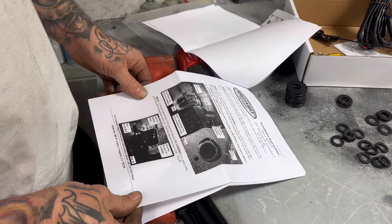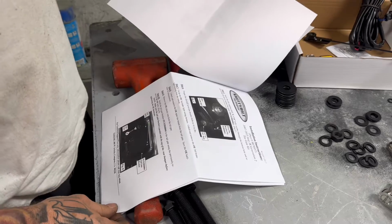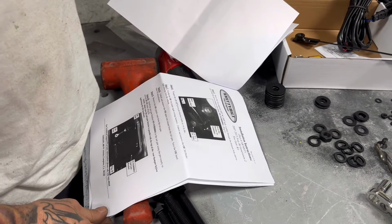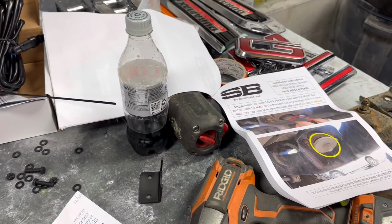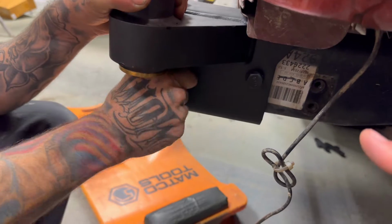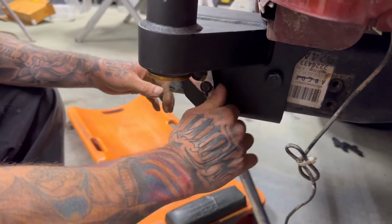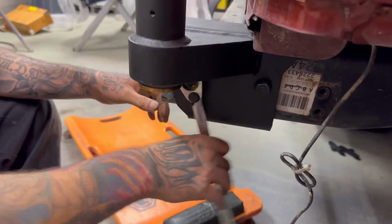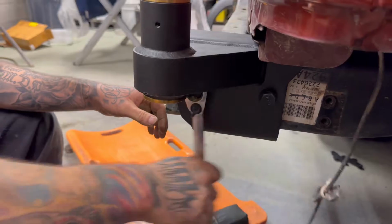So I'm so glad that we didn't go ahead and mount the bumper on because you couldn't get to it at that point. So if you're running the tire carrier, get those instructions out as well to follow along with these instructions. All right, so Mike is going to be drilling through the frame. There's a hole in the bottom of this already. So he's bolting it back on so that he knows where he needs to drill that hole through the frame.